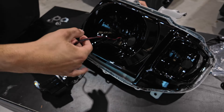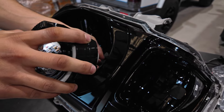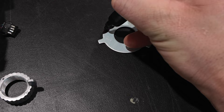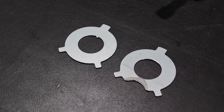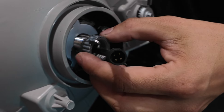With our painted lights back, we start by putting the projector in and feeding the cables through. These are the H4 lock rings — they hold the projector in place. We like to grind a little slot in these to pass the cabling through. This modification can be made to the headlight depending on what you've got, but this is generally the easiest way. You can see the lock ring slid in with the little notch where the cables come through.